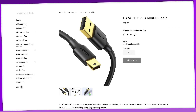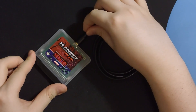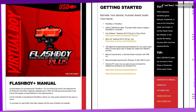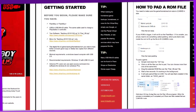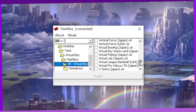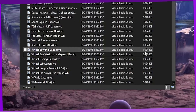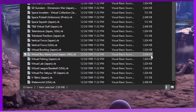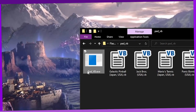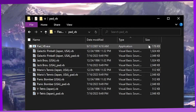The Flash Boy Plus optionally comes with a gold-plated mini-USB cable for an additional price, but I imagine any other mini-USB cable would work just as fine. Flashing the cartridge isn't super complex, but there are a few points to keep in mind. For total newcomers, there's even a digital manual available that's a useful reference. You connect the flashcard to your PC with the mini-USB cable and use a dedicated app to select a Virtual Boy ROM to flash the cartridge. The catch is that the ROM you are flashing must be exactly 2048 kilobytes in size, which is the maximum ROM size supported by the flashcard. For ROMs that are smaller, you have to use another program to pad the file out so it fits the maximum size. It's fortunately as easy as just dragging the ROM files that need padding onto the program itself, and once you've done that once, you'll have a collection of correctly sized ROMs to swap between at any time.